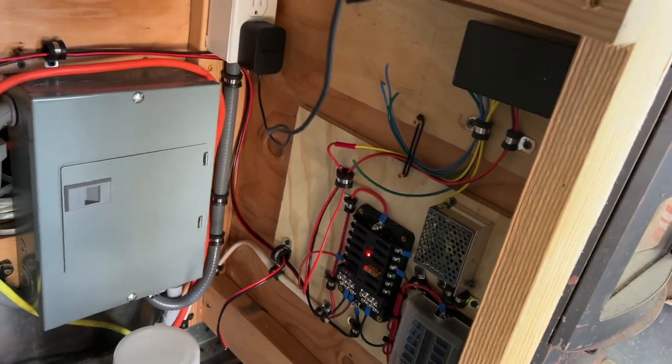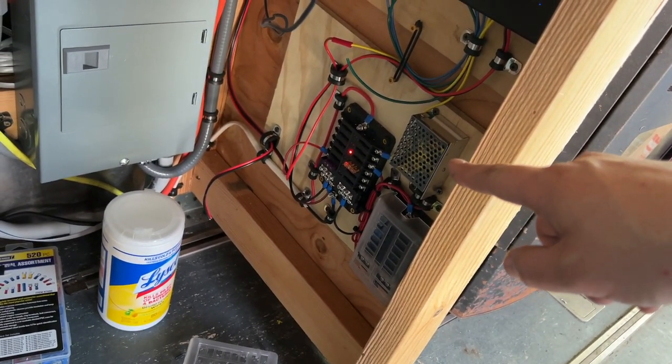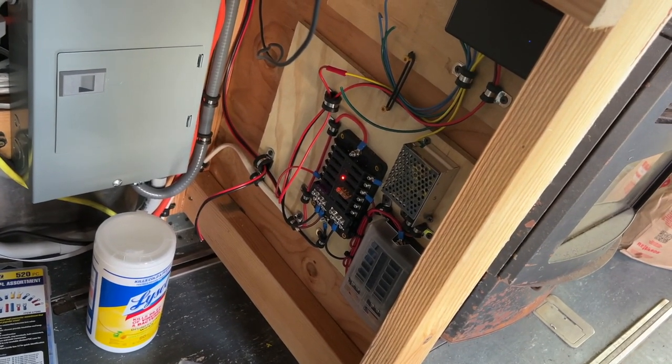Okay, right in the middle of a whole bunch of wiring, I'm going through and removing a bunch of the temporary stuff that I put in and putting in the new, more permanent wire. Allow me to show you. So we've got part of our low voltage panel down here. I'm going to be replacing that power converter with a Victron one. I don't really trust that little 5 amp thing. There's no fans or anything on it.